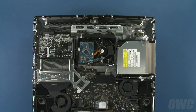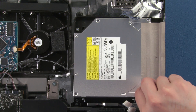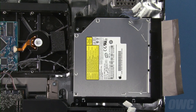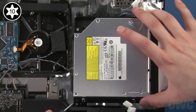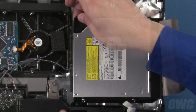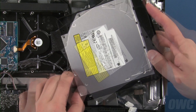The optical drive is located in the middle right of the iMac. The first thing we need to do is peel back the EMI mesh tape from the drive. Next, remove these two Torx T10 screws. Lift the drive out of the bay and disconnect the SATA cable in the lower left — it may take a little wiggling to get it free.